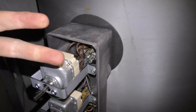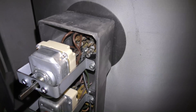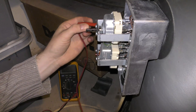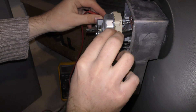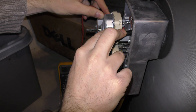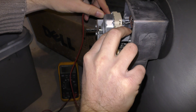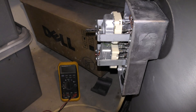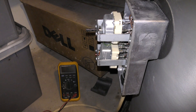I've been measuring those heating elements and we might as well do that again. If I take my connection, measure to the one that is common for them all and measure one by one — I have of course turned this off — I'm measuring 53 ohms on one of them, 52.9 on the other one, 52.3 on the last one. So more or less, I have three heating elements here, each around 52.5 ohms. That's a nice average.